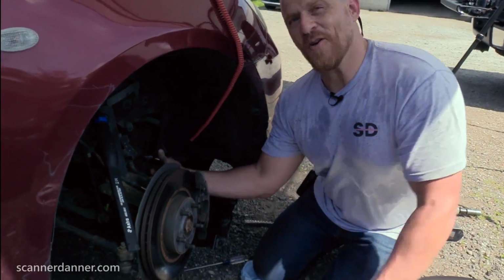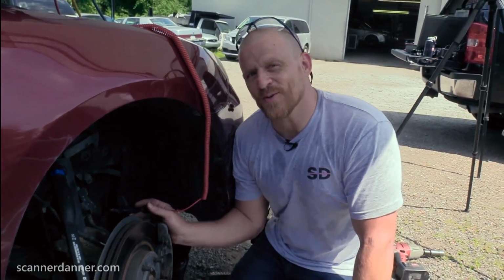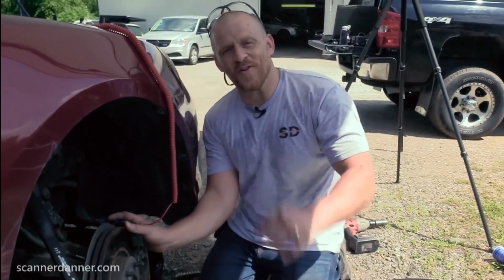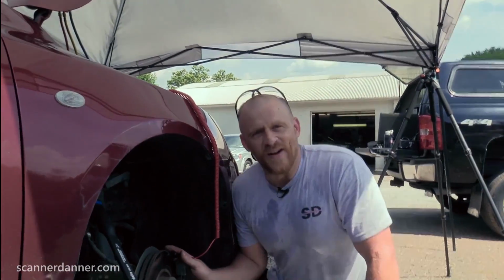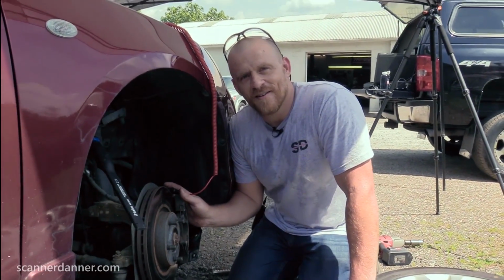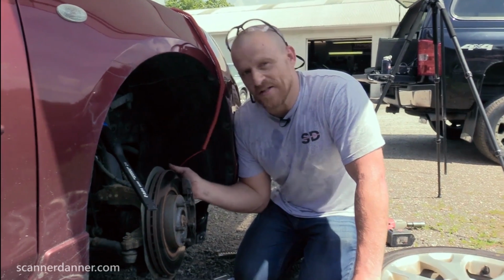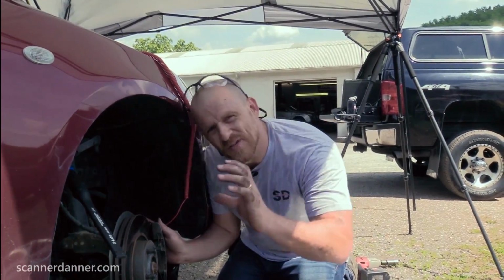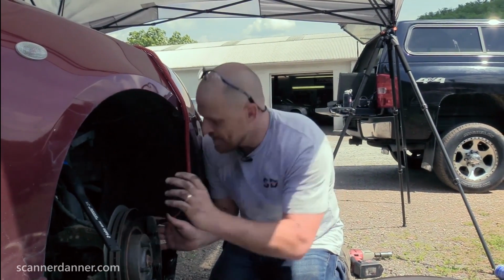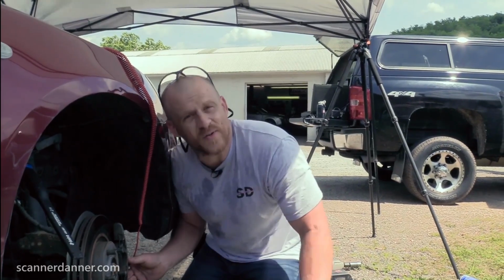That's so weird. I'll refer you guys. I have a couple of bad block ground videos where a faulty starter and where the car wasn't cranking, and I could make my test light on the engine block. Yeah, I'm gonna make you watch it, Caleb. I'll watch it. So it's that simple. With no ground wire on this, based on what I'm seeing, it grounds on the housing of the compressor itself.